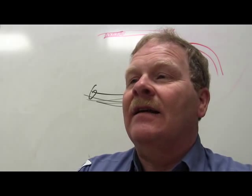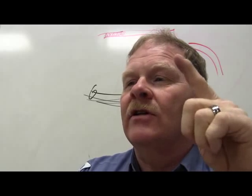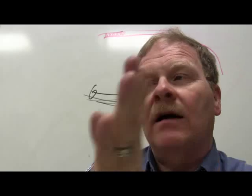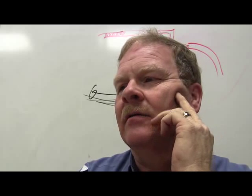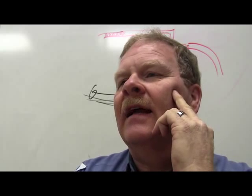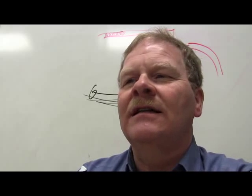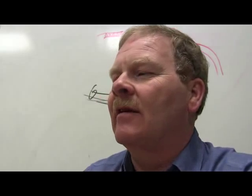The thrust line is a line that divides the left and right rear wheel toe. The thrust angle is the angle formed by comparing the chassis geometric center line to the rear wheel thrust line, measured in degrees. A right-aimed thrust angle that deviates from the center line is referred to as positive, and a left-aimed thrust angle is negative.